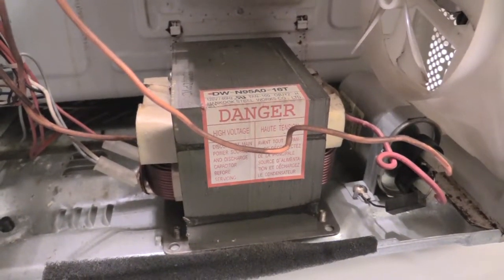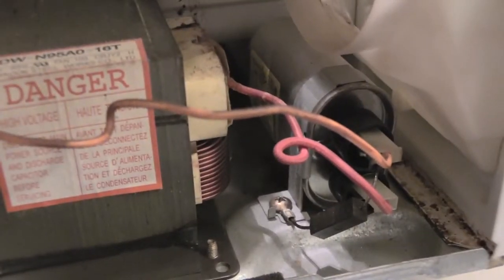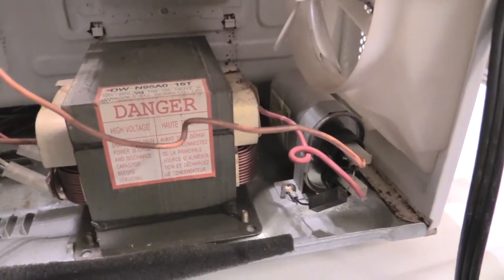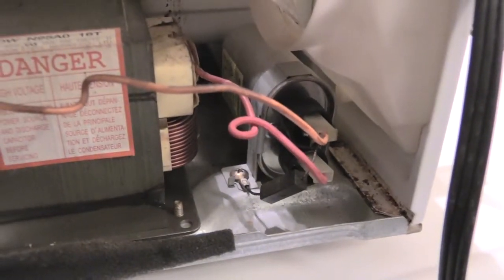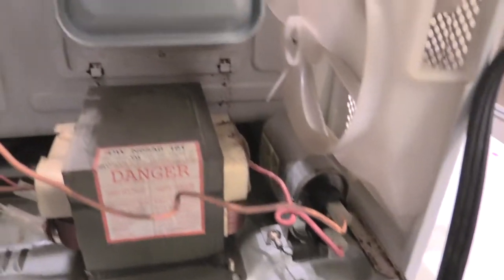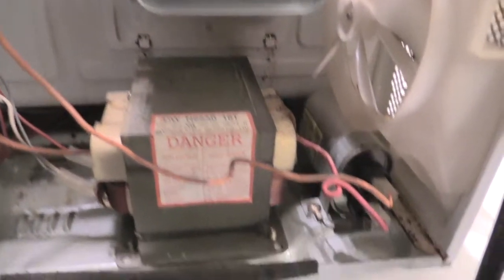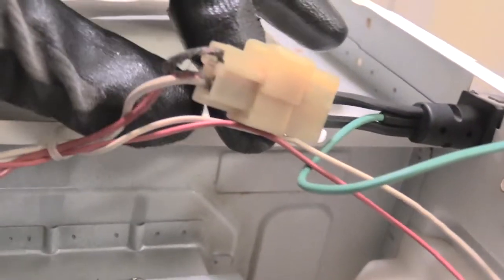On this microwave, like I said, most of the time when your microwave trips your breaker it's a bad capacitor. And if you turn it on, everything works but food is not heating up, then you need a new high voltage diode — one screw to remove, unplug it from the capacitor, buy a new one and replace it. But on this microwave, the issue causing it to trip the breaker wasn't actually the capacitor itself — it had a true short inside of it.